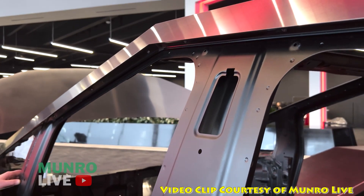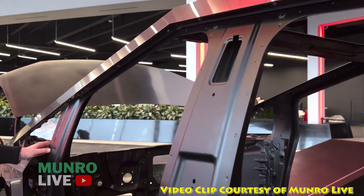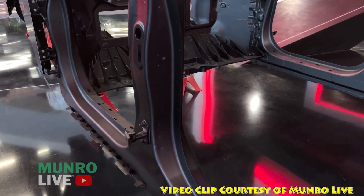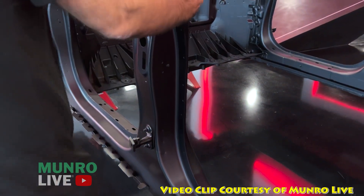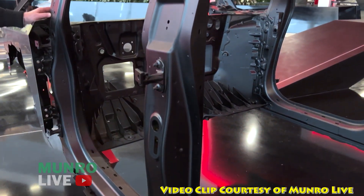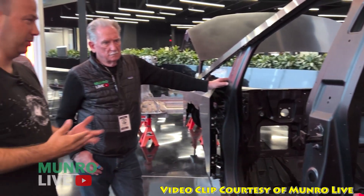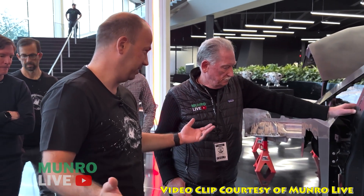It's simply coated with a black powder just for aesthetics, basically. So we're looking at a clean surface here, but it's high strength boron steel — single piece inner and single piece outer — and then we just spot weld it together. We do that down here at the south end of Giga Texas because, much like our castings, we had to make the press.